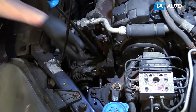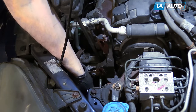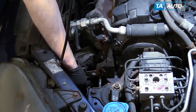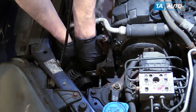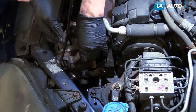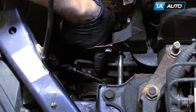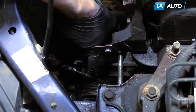With the lower bolt out and this bolt pulled as far as you can, use a good-sized pry bar and pry the alternator out. You should be able to bring it up and out. My adjuster bolt assembly is still frozen up, so I'm going to put a set of locking pliers on it and try to get it to come out and off.